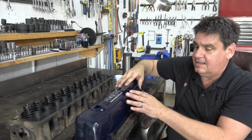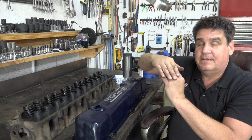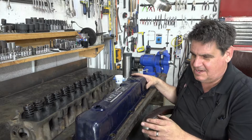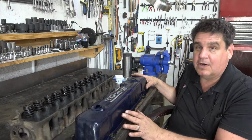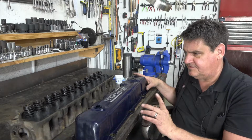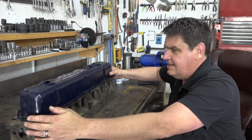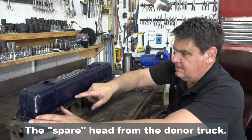And that way, it's kind of like a roof. When you do shingles on a roof, you always overlap them the way that the water's going to run. And again, in hindsight, that would seem obvious, but in this case, I thought I could make it work, but I was wrong. So what I'm going to do also this time is I'm going to bolt the new setup onto the head while I am brazing it to keep from warping.